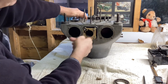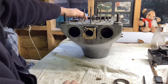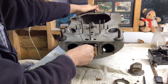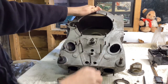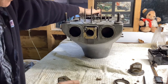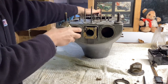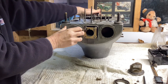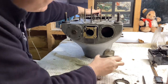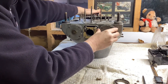On the JAP engine, the oil strainer and drain plug are in the middle; on this it's slightly different. The Praga and the JAP engine all have an oil pump that sits on the back case and draws oil from the sump. The Praga one is quite clever — it's got two strainers with the intake in the middle, so there's one strainer on each side. You only need to pull one sump plug out to drain the oil.